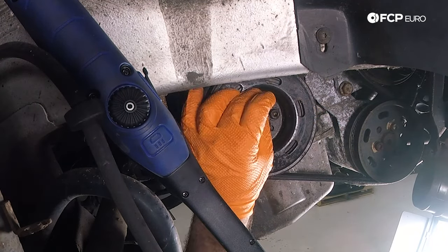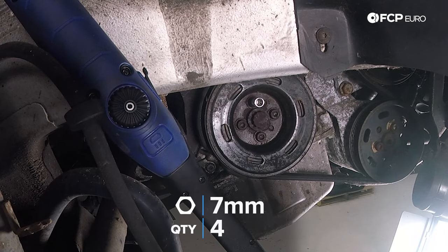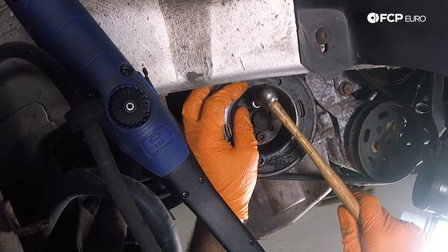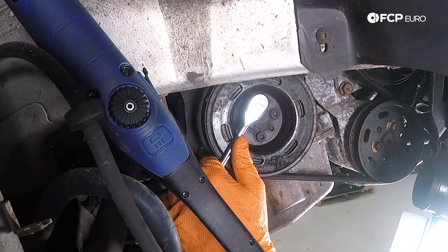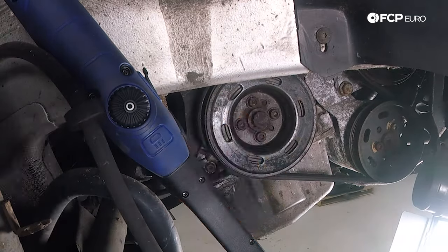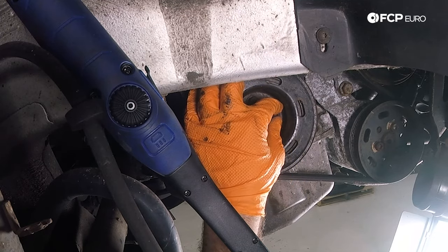Go ahead and brake-clean it out. Now you're going to take your 6mm Allen and insert it into the bolt. Take your hammer — just a small one — and make sure it's completely seated in there so you get a good bite. Then get your ratchet and crack it loose. You're going to want to do that for the remaining three bolts. We got all four of these bolts loose, and now it's time to lower the car. We're going to support the engine with a jack stand and a block of wood.